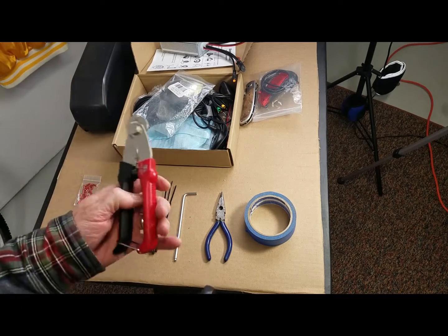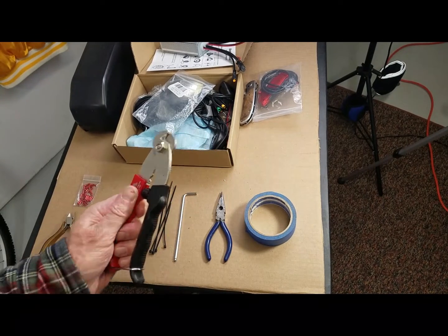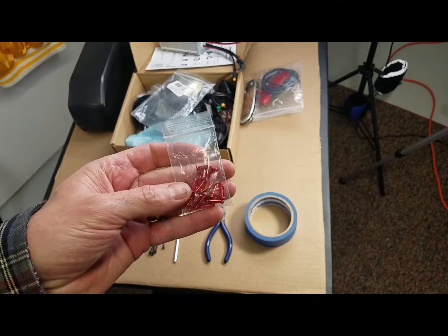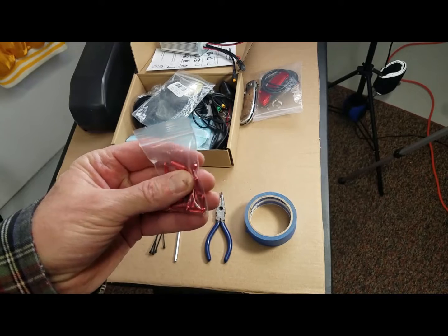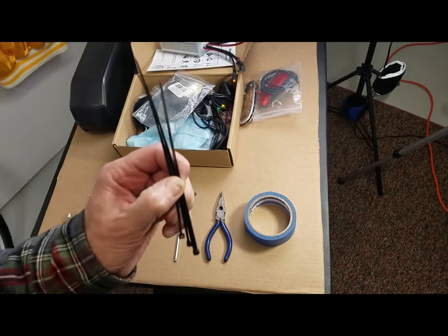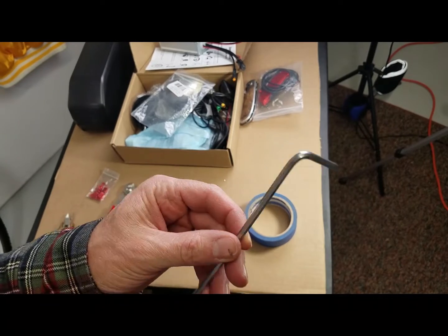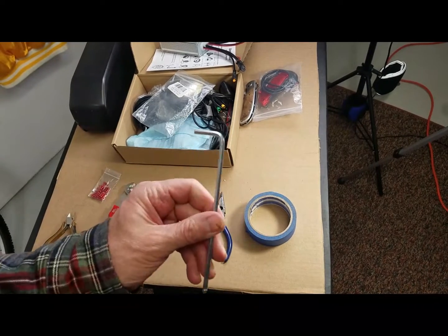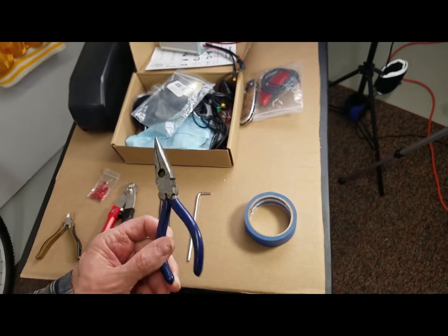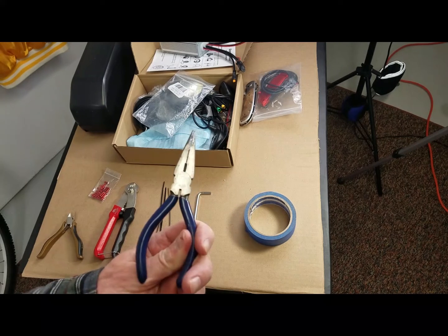What do you need to put it in? Get some good cable cutters for the housing and your cable itself. You're probably going to need some cable ferrule ends — these just clean things up. Zip ties to manage the wire, and usually an Allen wrench or screwdriver for cable and shift cable removal. Pliers mostly for pulling the zip ties tight and maybe tightening up the shifter cable as well.